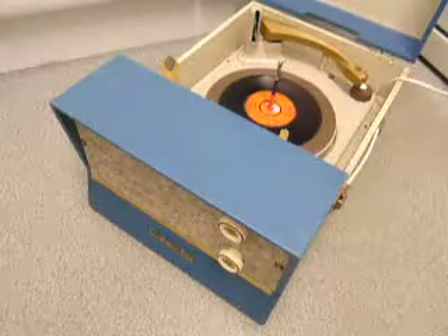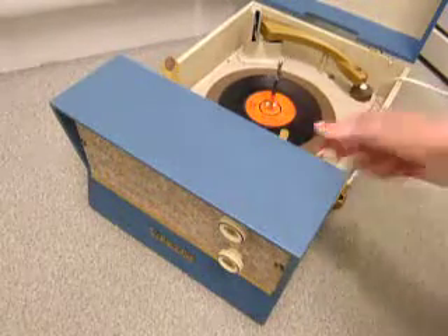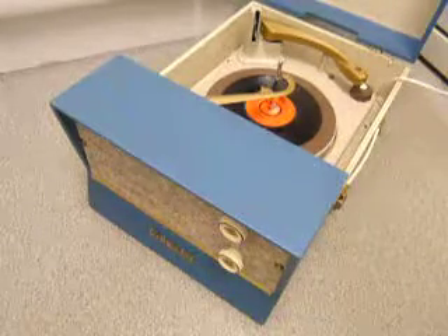Select the first position on the right-hand dial, which will start the turntable turning, and you can then place the arm onto the record yourself. Once the arm is on the record and it's playing, carefully lower the stacker arm down so it knows to switch off when it reaches the end of the record.